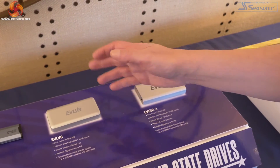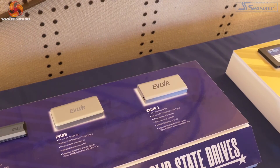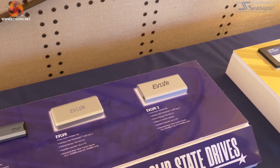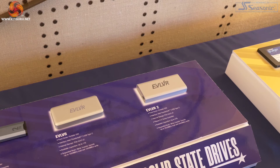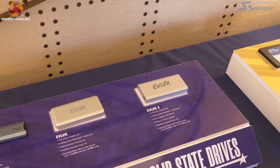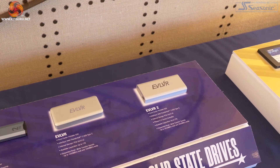The Evolver is now end of life and will be fading away soon. The Evolver 2, as the name suggests, is the coming thing — it's Thunderbolt, PCI Express Gen 3 x4, Phison controller, up to 2 terabytes. The big difference between Evolver 2 and PXD, apart from the Thunderbolt, is the consequential massive increase in speeds — reads and writes heading beyond 2.5 gigabytes per second, up to something approaching 3 gigabytes per second: 2.85 and 2.6 to be absolutely pedantic.